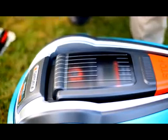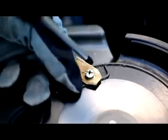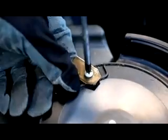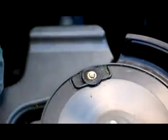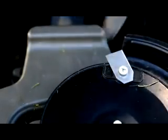Place your Robotic Lawn Mower on its back on a soft, clean spot. Hold the plate and unscrew the cutting blades. Clean the area under the blades. Use the new screws and attach the blades. Take care with the distance between the screws so that the blades can move freely.